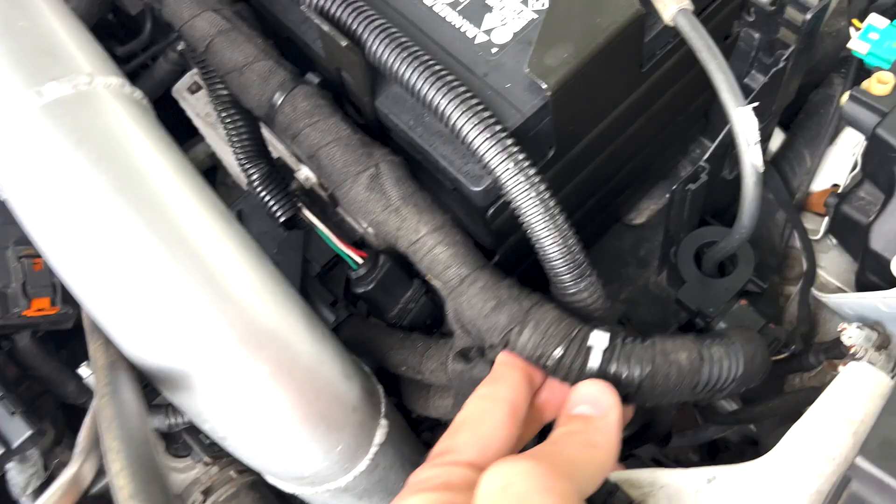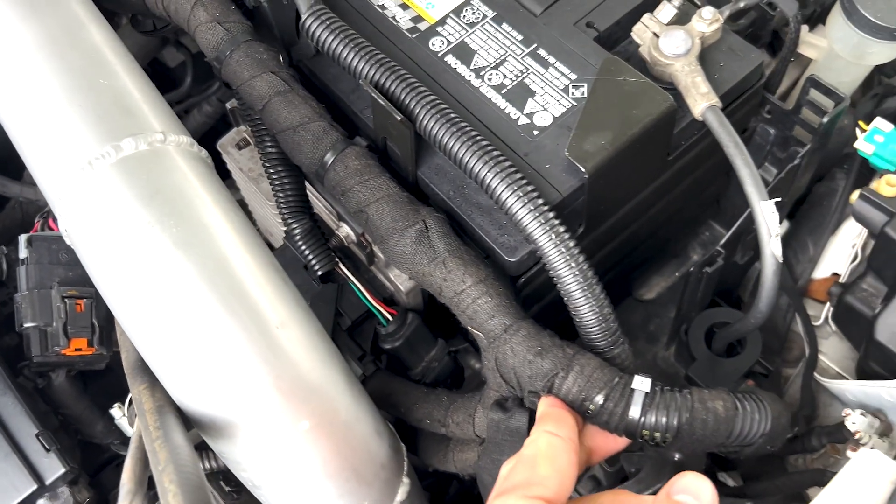Before we do that, I'm going to show you a little trick that will help make wiring your new ECU into your current car a lot easier. What we're doing is basically going to unpin the stock ECU and let the FT550 take control. We're going to dive into the computer and I'll show you what's going to be really helpful. There are plenty of free programs out there that you can use for mapping out your wiring, simplifying it towards where it's easy to understand — taking it system by system, gauge by gauge.